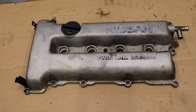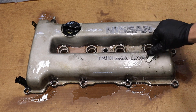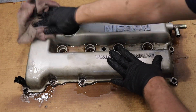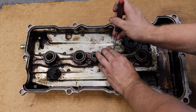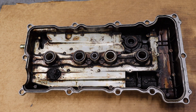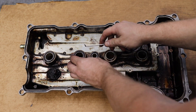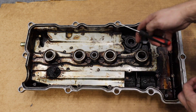Time to work over this SR20 valve cover and make it look a little more decent. Before we press the valve cover in, it's good to pull these rings out and replace them. If they're hard, they can be a bear to get out. You want to use a hook, kind of hook it up and pull them up — they do get hard and plasticky. Be careful not to mess up the mating surface. Go ahead and pull all four of those out and replace them with your new valve cover gasket kit. There's also a little rubber one right here, smaller than the four spark plug ones.